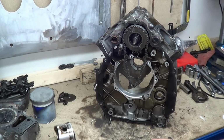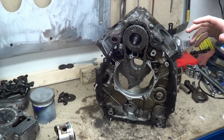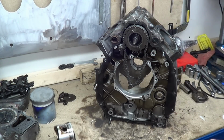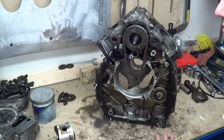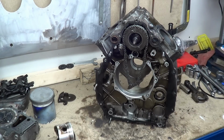So that means that out of the four strokes, it's only two strokes that we need the valves to be open. If this was 1-to-1, with the crankshaft turning once and the camshaft turning once, then you'd have very skinny camshafts, because they'd only open a quarter of the turn of the camshaft, where in essence we want half of the camshaft doing work, not a quarter of it. A quarter's very hard to manufacture. It's very hard to machine. It's not hard to design, but it's very hard in real life. The strength of the camshaft would be bugger all, etc. You'd have a very sharp angled cam that would only pop up once every four strokes for each cylinder arrangement.